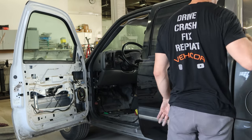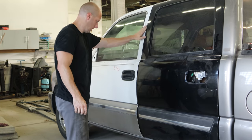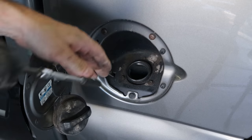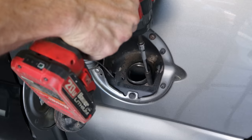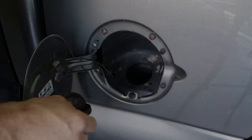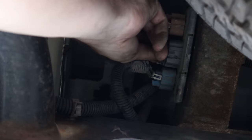The door check isn't out of the back door — it's actually in the back door. We dropped it down inside. The color doesn't match at all. So now we're going to take the bed off because I don't feel like doing any pulling work right now — the Scott-powered ram is resting up. Unbolt the filler neck, unplug the tail lights — just one harness for each side. We'll tuck the wires up inside the bed so they don't get snagged.